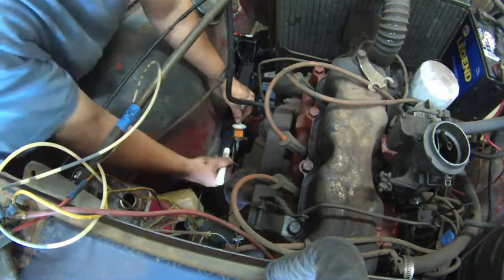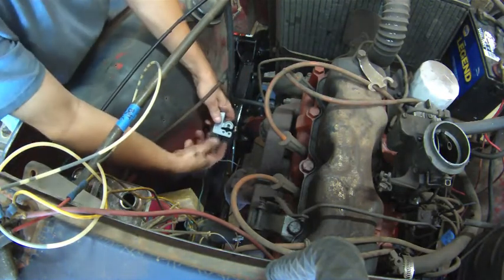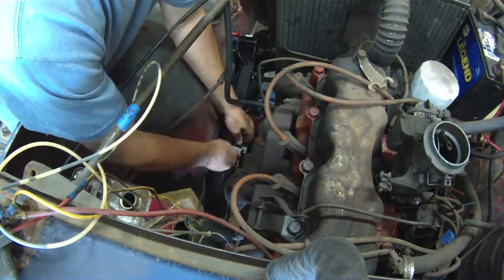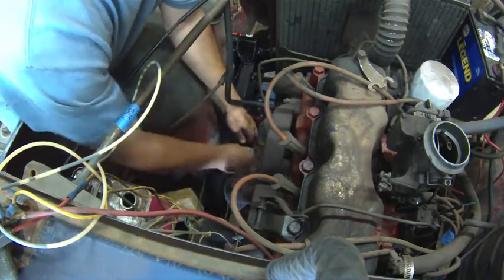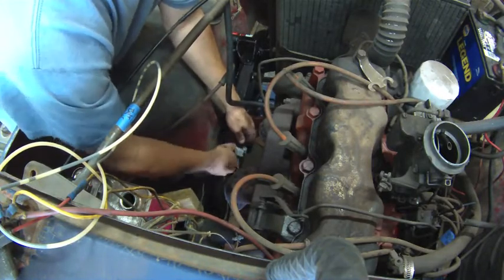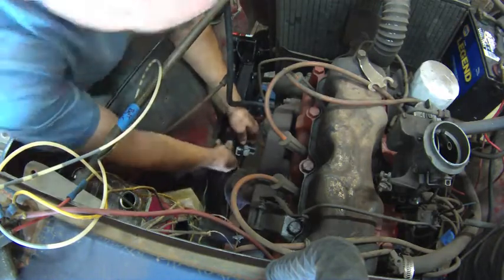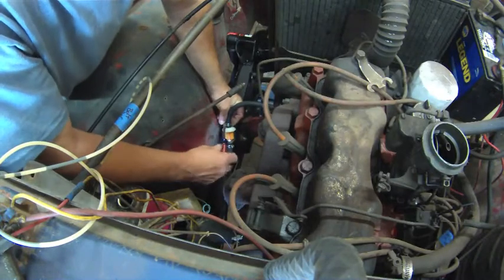Marking the fuel line where I'm going to install the fuel filter, and for those that are paying attention, that's the other end of the fuel line where I started to make that bend and didn't have the flare nut at the right spot, so there it's stuck where the bend started. So I'm cutting that free, and then this will be at the proper length so that I can install the fuel filter and make the final connection to the fuel pump.